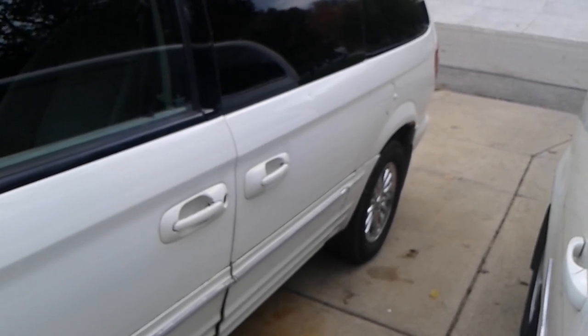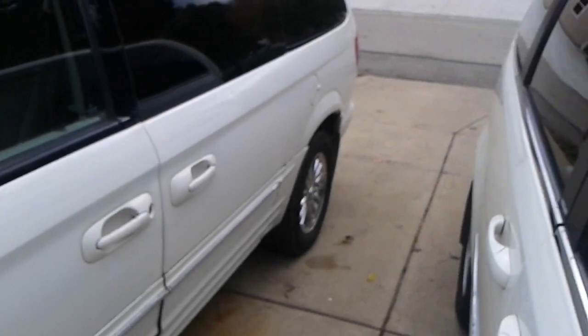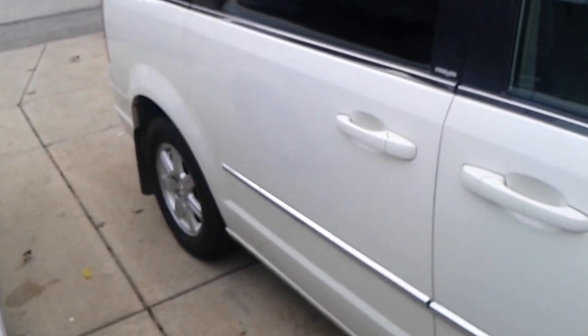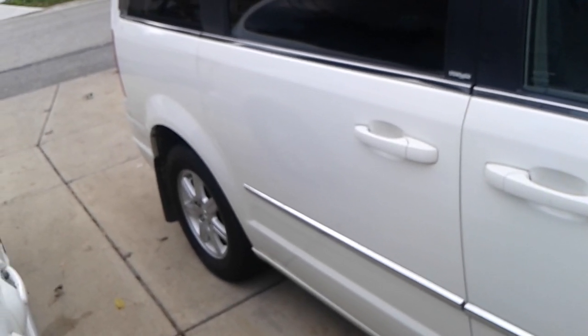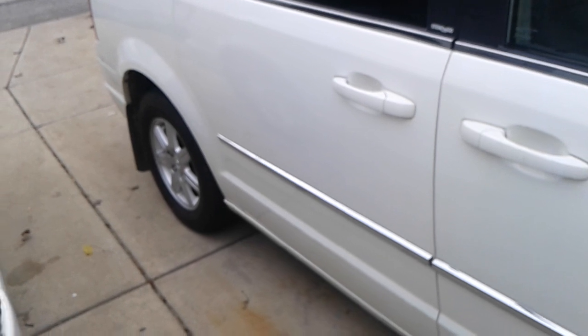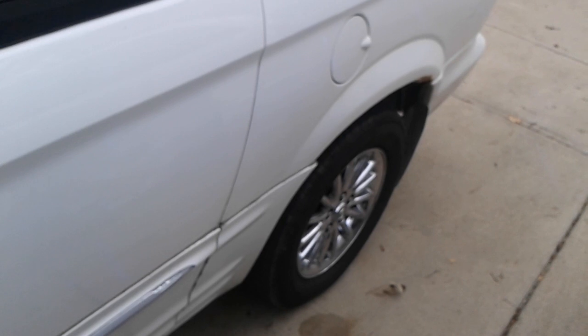So with every tire rotation or every 6 months, I'm just going to get into these vans to prevent it, because even this van did it too. This one has a different ratio with the brakes. I think it's like 50-50, where other vehicles are 60-40. So lubricate the slides on these, because if you don't, they're going to hang up. But now I want to go through my brake fluid, since that was all hot, and get that out of there.